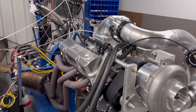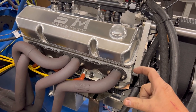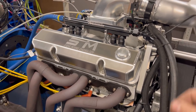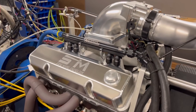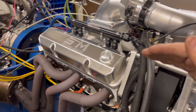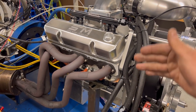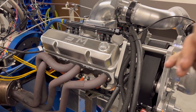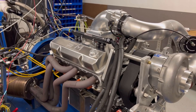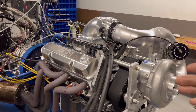With our normal stuff — a copper gasket, our SMX hoop program that we put in there, a chamber mod on an AFR cylinder head — keep in mind, and I've told Shannon this, that there is not a small block Chevrolet in the world that is not going to have a head gasket problem eventually with big horsepower stuff. It just is what it is, so you just have to keep track of that. We've made this with the head gasket receiver groove, hoop program, and chamber mod — this is about as good as we can get it. But it'll still end up eventually starting to leak a little bit, and as you lean on it any harder than the 1,500-ish range, a 2,000 horsepower small block Chevrolet is a head gasket eater.